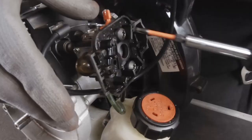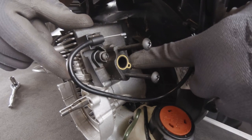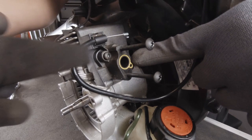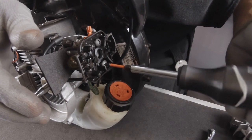Now we want to block off the intake side as well. We're going to remove the air cleaner and loosen the carburetor. Most two-stroke engines are going to have a plastic manifold — we want to test that manifold and make sure there are no cracks. So we're going to set our stop after that plastic manifold, making sure we're bottoming out at the mounting screws, slide it in, and tighten everything back up.